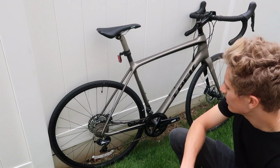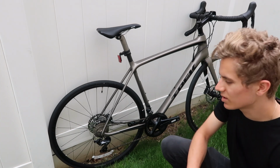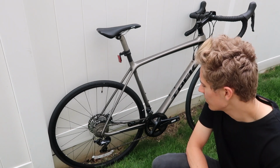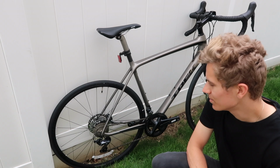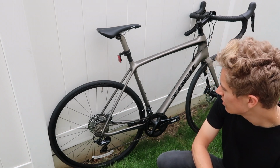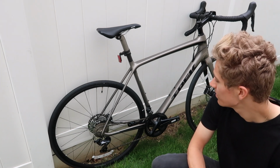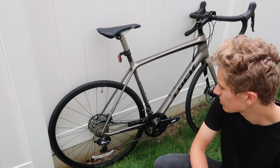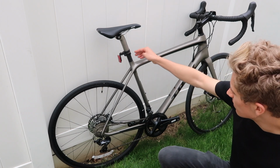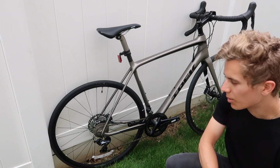But yeah, the disc brakes for this, I guess the advantage is I might want to hit some gravels. In Vermont there are a lot of gravels, so it might be really good for that. And also you can put really wide tires on. I was trying to decide whether I want a 28 or a 32, but I noticed how much more comfortable a 25 from a 23 was on my other bike, so I may be fine with 28, because this seat mast design, which has a 20mm offset, is really going to help with the compliance.